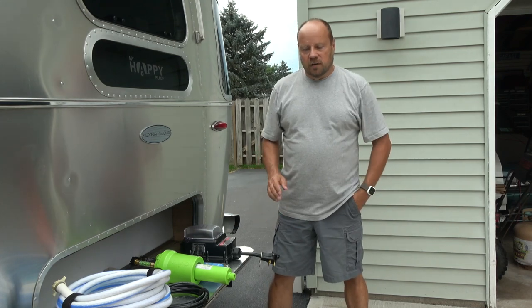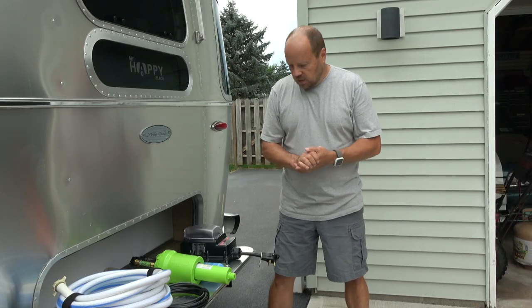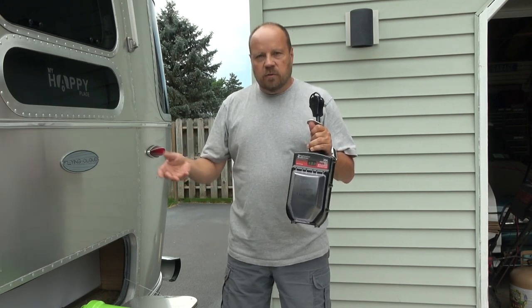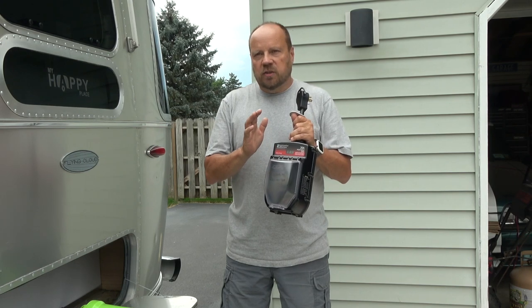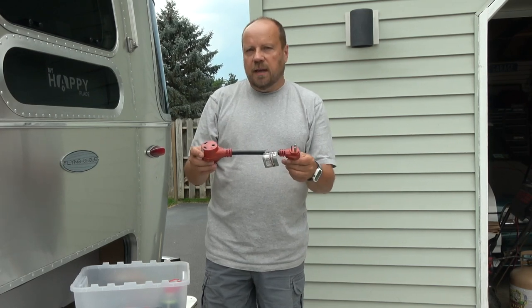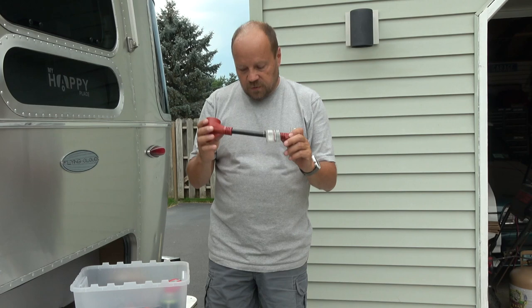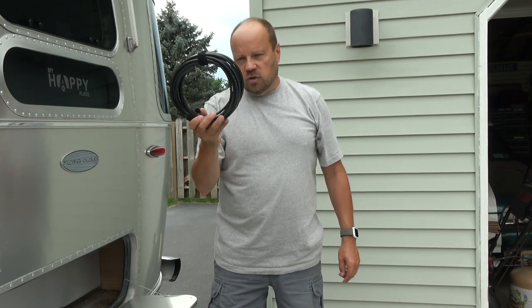There's a lot of external gear you want to make sure you have in your RV — gear you'll probably acquire and just keep in your RV at all times. You want to make sure you have a surge protector for your electric. Along with the electrical cord that came with your RV, this will test your power and make sure it's clean so it won't harm your RV. On the electrical side, pigtails — make sure you have the appropriate ones for your rig. This is a 30-amp to 20-amp pigtail. You may also need a 30-amp to 50-amp pigtail. Some campgrounds only have 50-amp, so that can be handy. If your RV is wired for cable TV, make sure you bring a coaxial cable.